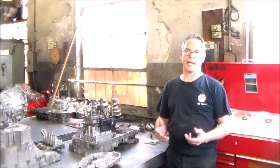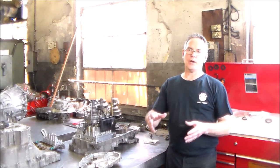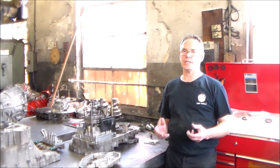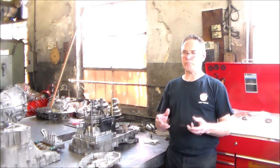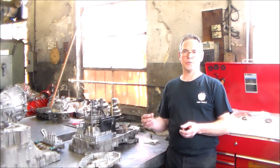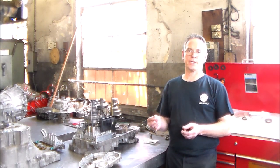This was an 09 Honda Pilot that came in with a third pressure switch code, but these have such a high failure rate that we do them all. Because you don't want to come back again with the D-light on — now you have a fourth switch. You've got to take some stuff apart on the transmission that's really not a simple 1-2-3 thing, but if you can locate it and get access to it, you just unscrew the old one and screw the new one in and plug it in.